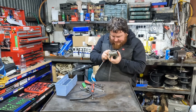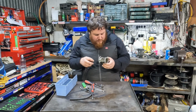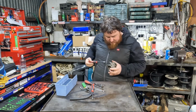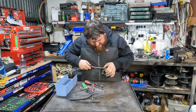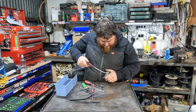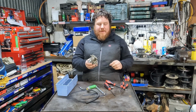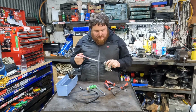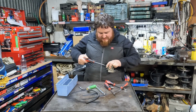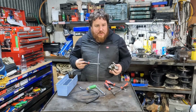Here's one of those damaged screws, and it's gonna be a problem. Said somebody's had a go at it, and they've really chewed them up. Makes life difficult. This one here. Oh, we got this one. Looks to just be a cap of sorts. Okay, so a little bit of struggling. I have managed to get some of these other ones undone. I believe they're just covers or plugs, so it's not anything too critical. Essentially, I just put a bit of heat into them, put them in the vise, and that was enough to get them moving.